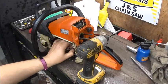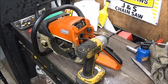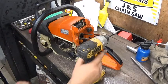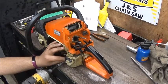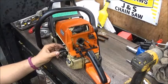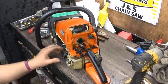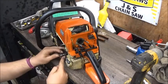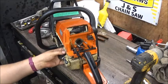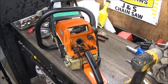That's funny - that one has two ground wires. But this is a plastic case saw, and I'm assuming one ground wire does go down to the bottom of the crankcase. I'm trying to get this coil wire off. You don't really want to pull on it - you want to try to push that off. It's just a slip-on connector, and she came right off. Then we've got our plug wire that's ran up behind the tank, so we'll just leave the coil hanging there for now.